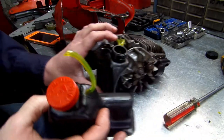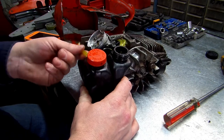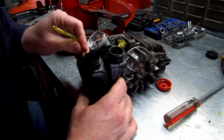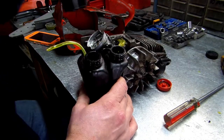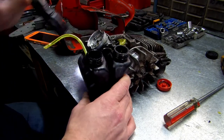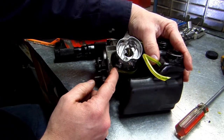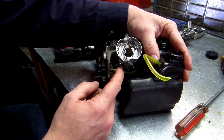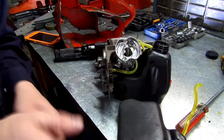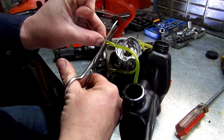Let's get our gas tank on. And she goes like this. I got a lot of extra in here, so I'm going to pull it out. Yeah, I made sure I had a lot. Okay. Gas tank goes into your carburetor. It is the only inlet. It's the only nipple on your carburetor for a line to hook to. Okay. Let me go ahead and get this cut flush.